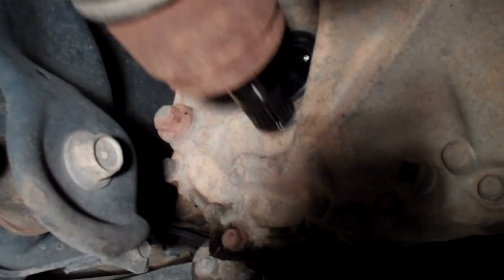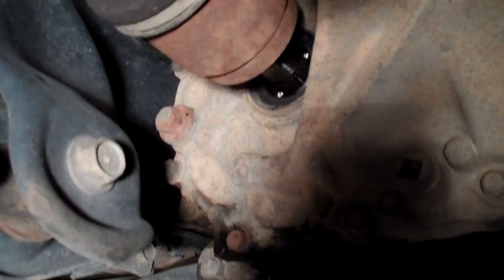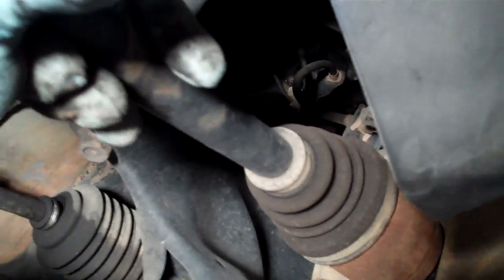You'll twist it when you put it in, and then when you drive it in, you don't hit it with a hammer. It's like the whole axle is a slide hammer. You can slide it in and out and just kind of jostle it and it'll click in. Just like I jostled to get it out, you jostle it back in. That's how you remove your CV axle.